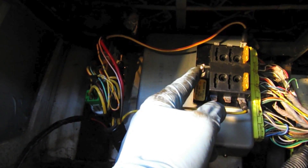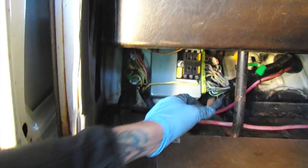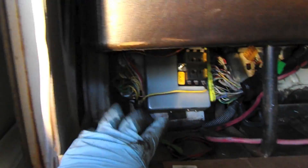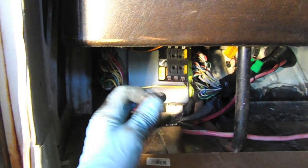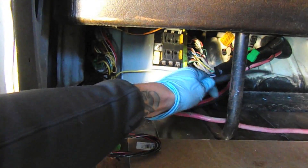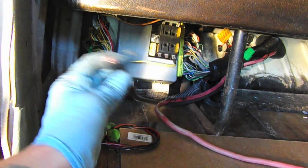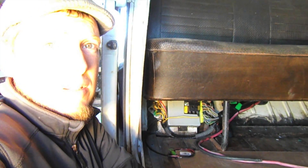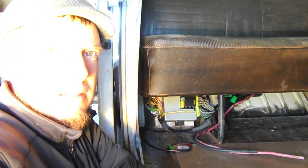I'm going to create a lead from this main terminal to the battery. I'm going with a side post battery — similar to this one here, you can see these side posts — it's going to sit right here. I'll create the battery tie-downs. Then we have grounds connecting directly to the battery, and going to the starter we have a negative lead and a positive. That's the wiring harness all tied up. For the next part, we're going to complete the chassis preparation and get the engine prepped and installed — so stay tuned.